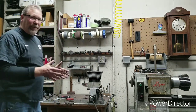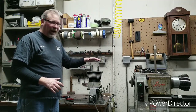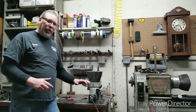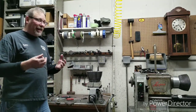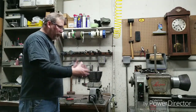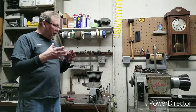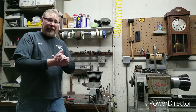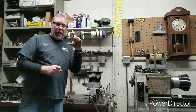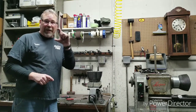You want to simulate everything that you're doing when you're putting this motor together so that it is true and as round as possible. I could advertise that I bore and hone these with torque plates, but if I use the steel ones, they don't do anything — they don't represent anything, other than the value of me selling you an American-made lifter where only the box is made in America, not the lifter itself.